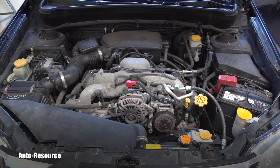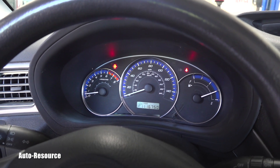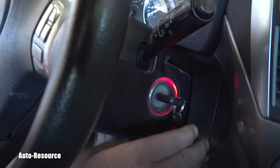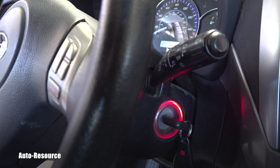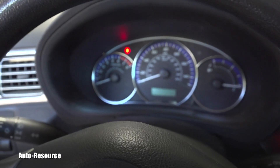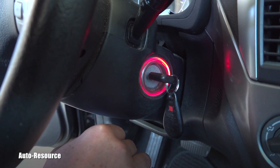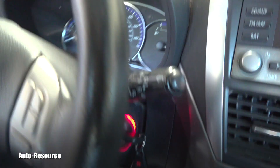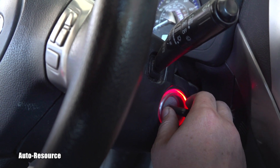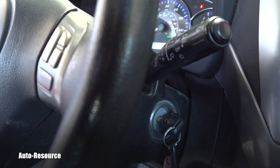After 10 minutes of idling, I switch the engine off and wait 20 seconds — everything is off. You can keep the key in the ignition, it doesn't matter. After 20 seconds, I put the ignition on without starting the engine, and that's for 10 to 15 seconds.